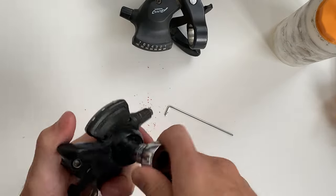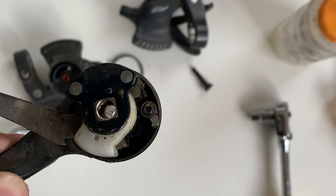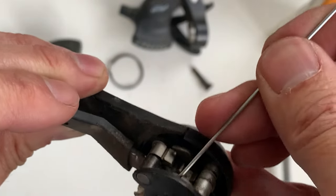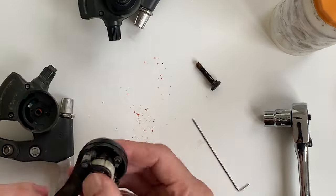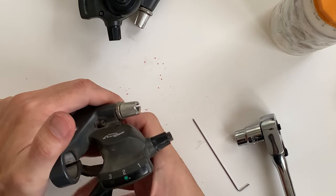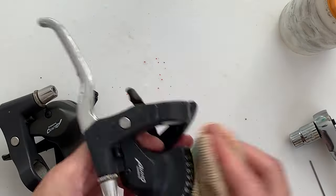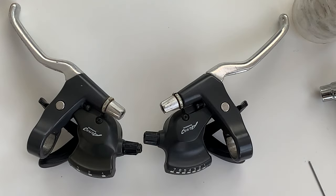Usually, once you free up those teeth with WD-40, it ends up working. You can see how crisp and clean the shifting is now once it's cleaned up. I've heard other people also use boiling water, or try to use an air compressor to blow it out. But this is what I usually do — I take a look inside because you can see what part's moving. Here I'm just showing you the teeth again — when I pull it out, it doesn't spring back and engage with the cog. Repeating the same process again, just the WD-40 goes a long way. You can also re-lube it after the WD-40. You can see it's shifting pretty well — sometimes that's all it takes to fix shifters. Other times you might have to take it all apart, but if you have old shifters that aren't working, usually you can fix them. They're made pretty well — it's usually just old grease and gunk in there. Hopefully that helps people out.